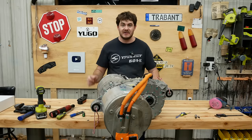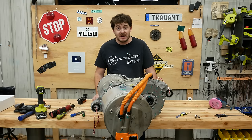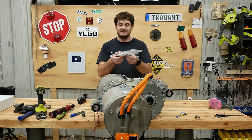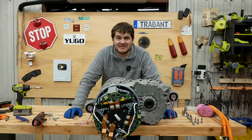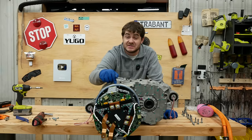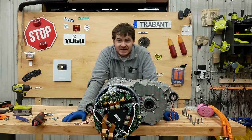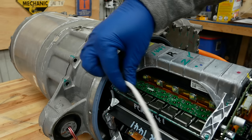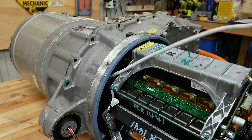The control board is installed on this one, but I'm not done yet because this is the front motor and it'll be mounted backwards, meaning it runs in reverse. That causes no issues except for the oil pump in the gearbox — it's designed to run in one direction, and since I'll be running it the other direction, that's a problem. So I bought this from Zero EV in the UK: a reverse oil pump for the Tesla drive unit. It uses the internals from the stock oil pump but in a different housing. That means I have to split the gearbox in half to install it. I took the inverter housing off again, and I'm glad I did — there's a sensor with two wires that got sandwiched between the inverter housing and gearbox housing, and I stripped it wide open. I fixed that with some liquid electrical tape.